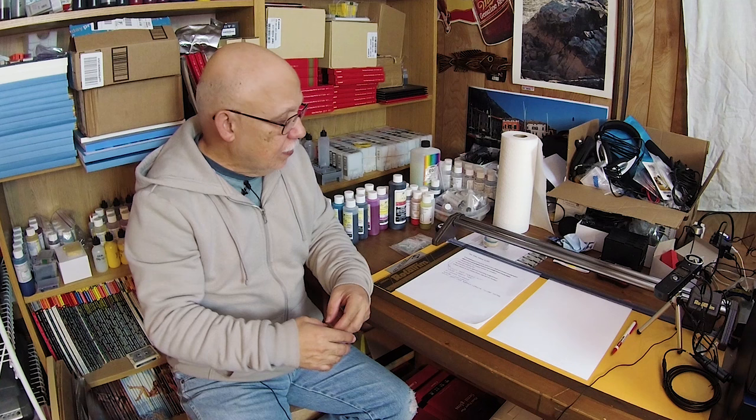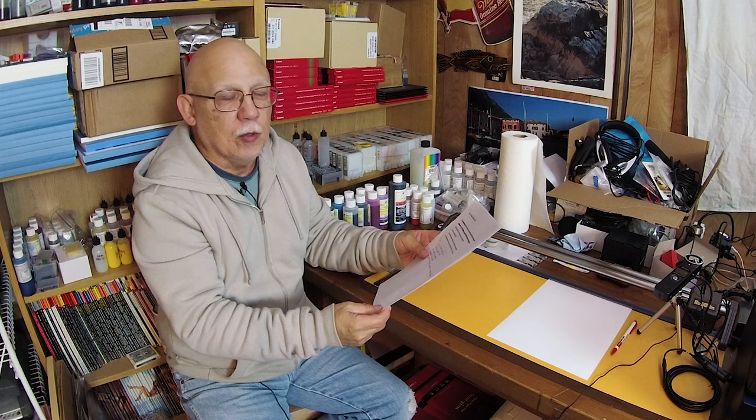Why did that occur? Maybe you didn't use your printer for a while, or your refilling technique isn't as good as you thought. If you're using OEM cartridges, you may have let the printer sit far too long and now the balance is off because you have nozzles that are clogged. Run a cleaning cycle — that's what the cleaning cycle utility is for: to repair what you did to your printer by not using it. Do that first before you imagine all sorts of horrible things happening. Usually it's very simple and you will solve it.